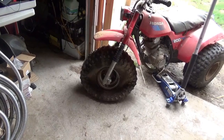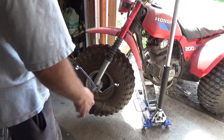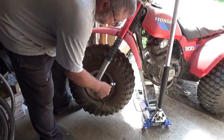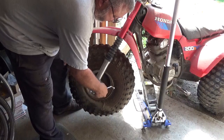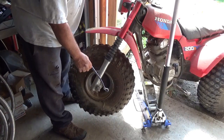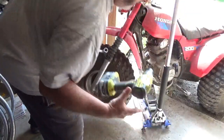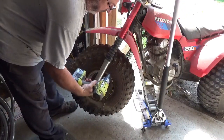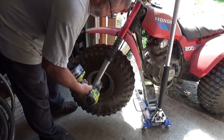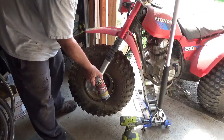I have the feeling that if the slime doesn't work, I'm going to have to change the front wheel anyway. To distribute the slime well, I'm going to pull this front wheel off. The best way I found is to just loosen these - don't take them off completely - that way this block still supports the axle as you try to turn on it. I've also tried the spoon wrench for removing these but you really need a hammer gun; make sure your direction is right.